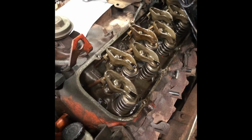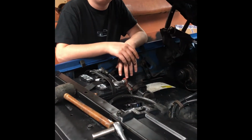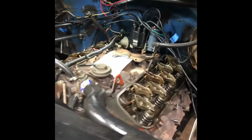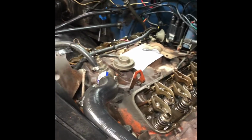So yeah, passenger side's missing number two, which would explain that spark plug having the afro on it. That would explain clanking that you thought was from the drive shaft. Yeah, the motor's kind of shaking. It was a bad misfire, and I thought it was a carrier bearing off the drive shaft. Well, good thing you got it. At least you can just replace it.